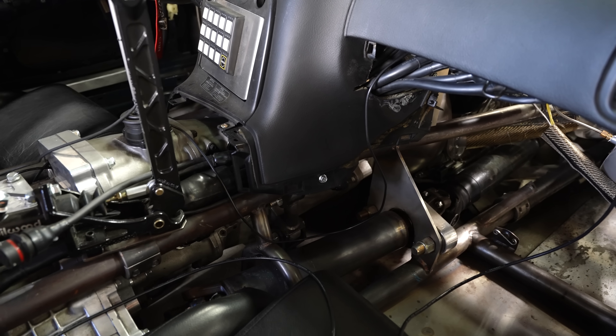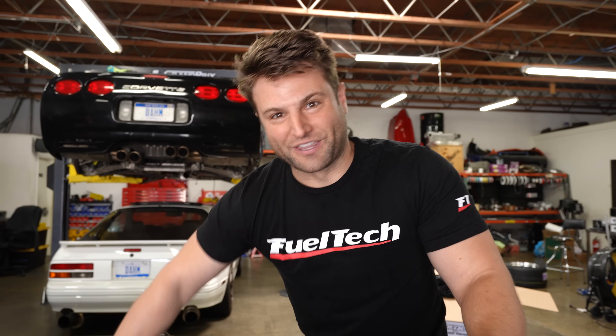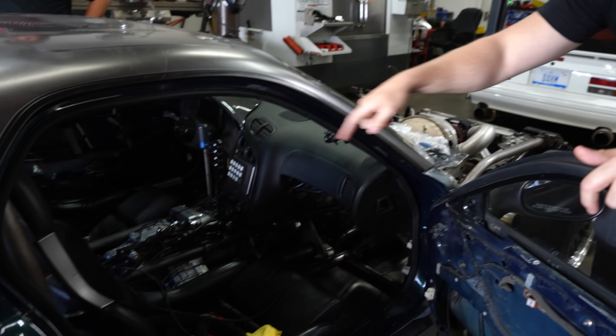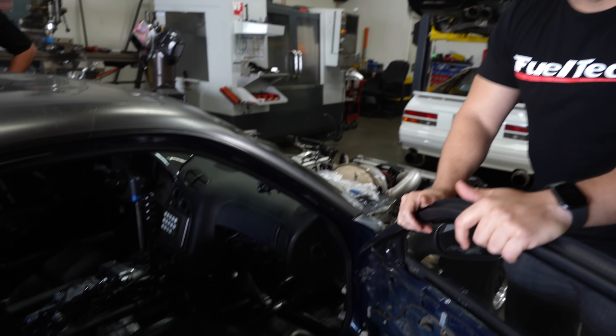Shrapnel is my biggest concern, so those two areas are getting fixed. Also, Isaiah was burnt to an extra well-done crisp with the heat coming off the whole side here, especially with all the fans pushing air straight through, so we're building more of the firewall. It's in steps and phases because this is a very weird custom setup. We're doing pieces as we understand them, because very easily you could plate off some of these things and they'd be stuck in the car — you could get the transmission actually physically stuck in the car if you put a couple plates on there thinking it's going to make it safer, and now you can't take the car apart.